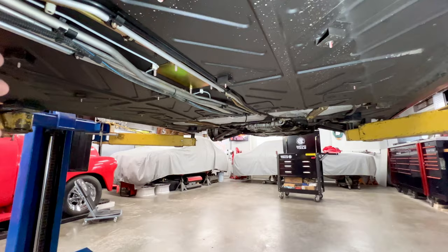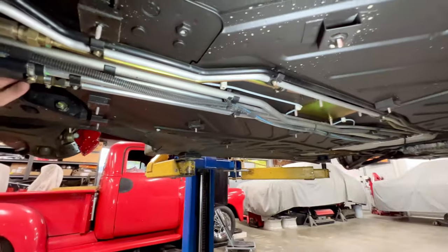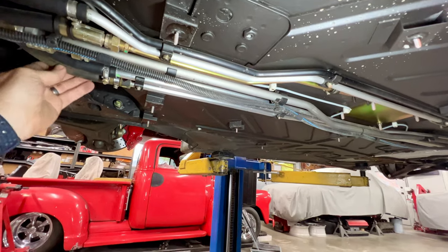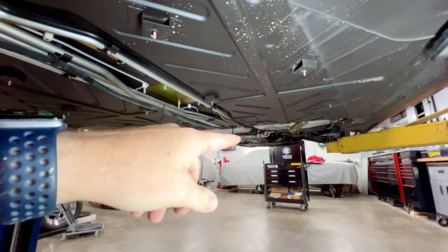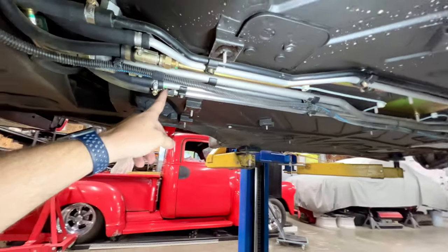I've worked on tons of cars my entire career, but for some reason, on the Ferrari and Maserati brand, it is very common. So we tighten those hose clamps up. We'll need to address the coolant leak that's causing the big leak at the back of the car. And then we'll pressure test it and make sure these aren't leaking and they don't need any other attention.